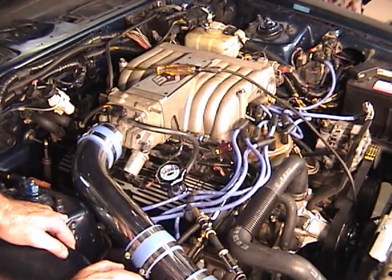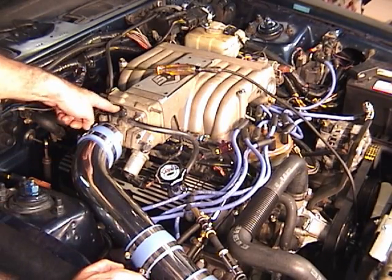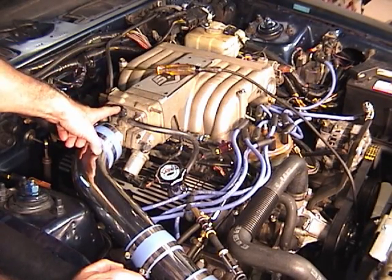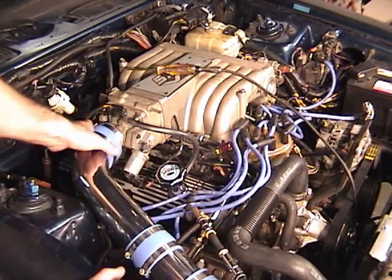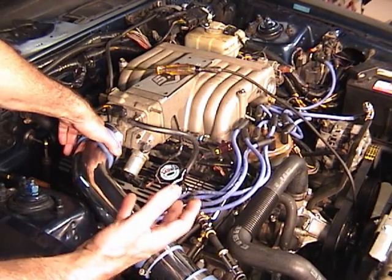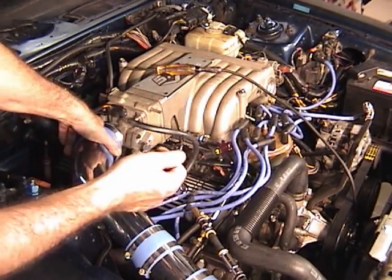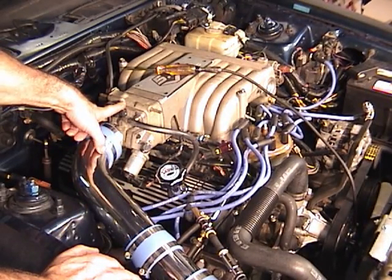So if you suspected that that might be the case, you could back probe your throttle position sensor and see what the voltage is. If it was like 4.5 volts, that would signify probably a wide open throttle. But it's an easier way than that to check. Just simply unplug it. If you unplug it, the processor will go to a kind of limited strategy. It will know that it's an open circuit and the injectors should pulse. So unplug it, try it again. If it pulses, then most likely you have to replace the throttle position sensor.